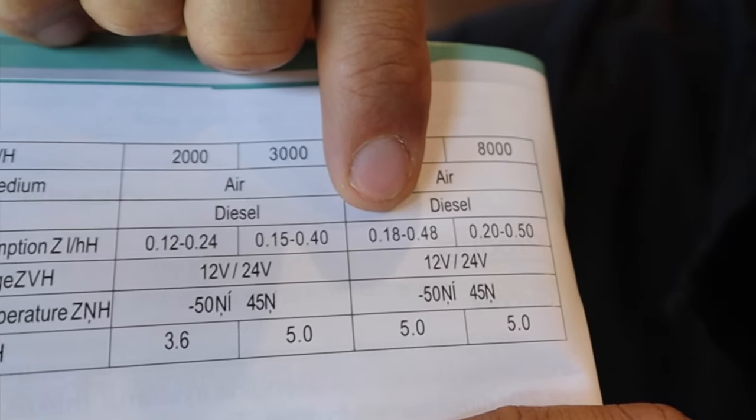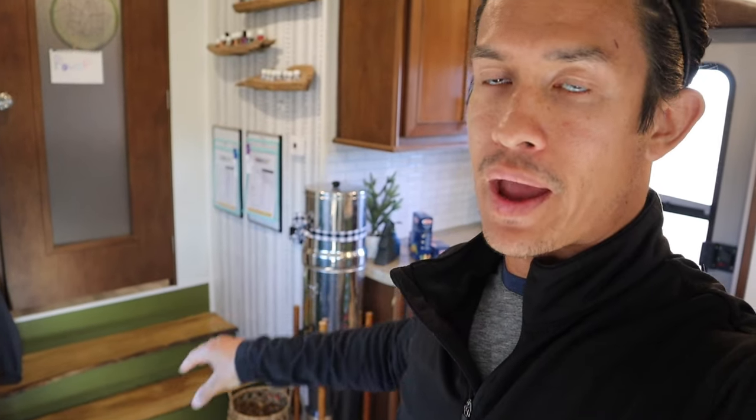As far as fuel consumption goes, I have the 5-kilowatt unit, and the user manual shows it consumes 0.18 to 0.48 liters per hour, which I have found to be very accurate. That range just depends on how hot you want it — how fast that fuel pump has to deliver diesel to the heating unit. Now let's go take a look at exactly where I installed it, how I installed it, and we'll take a look at the pass-through to see where the fuel tank and fuel pump are located. I like the location of that unit because just on the other side of that wall is our battery bank, so the wires had a very short run to go over to our electrical panel and get power from our batteries.